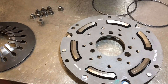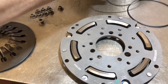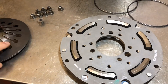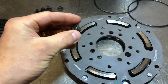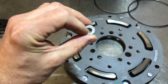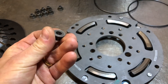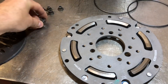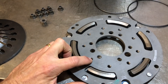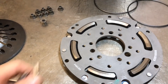Back on the bench we've got the two rings — one goes below the springs and one goes above the two springs we're going to use to build the clutch up. We've got the top section of the rivet which held the springs in place. These are now drilled through with an 8mm diameter hole and deburred so there are no sharp edges. We're going to be reusing these sections of rivets.